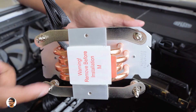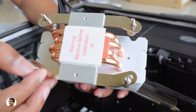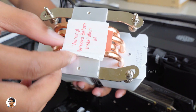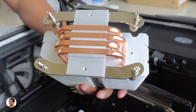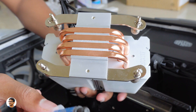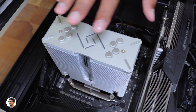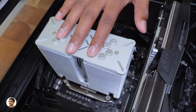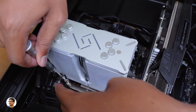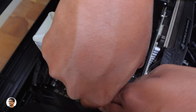There's no need to get confused anywhere — the company provides you with step-by-step installation in the manual. Once after installing the mounting plates, we need to fix the heatsink on top of the CPU. Remove the sticker on the cooler's base, and before placing it on the CPU don't forget to apply some fresh thermal paste. After applying the paste, carefully place the cooler on top and align the screws on the mounting plate with the holes on the motherboard's backplate — it should sit firmly. Now tighten up all the screws so the heatsink is sturdy and fixed firmly in place. We're about 60% done — we've successfully fixed the heatsink.